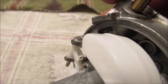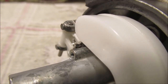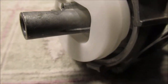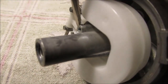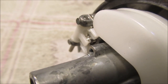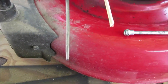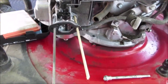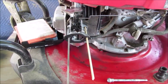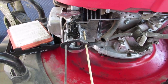That little plastic flange — I even took a picture of it. You'll see a mark on the white plastic on this side so you know you've got the float in the right way. There's a little mark because the metal/aluminum gets kind of black tarnished. Bonus tip: use a wooden dowel, a chainsaw file, or a bolt with the head cut off to help fit the hose over the carb with the gasket already on.